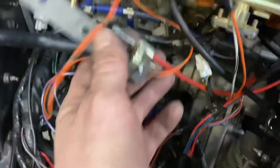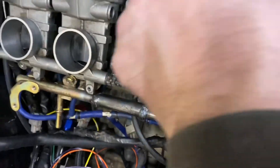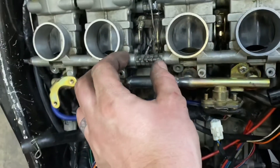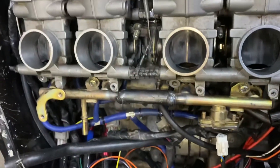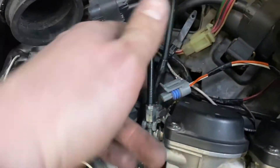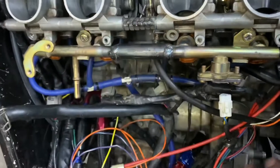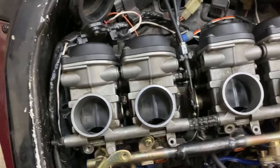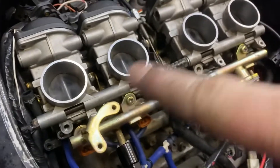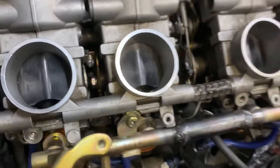Now I have my cable bracket for the idle advance — or the warm-up stuff. I might have to recreate that bar because I was a little too tight here in the middle and it wasn't fitting the boots super well, so I just had to redo it all. I also didn't like how that throttle cable was, and it's still a problem, so we're making small progress. I'm going to redo that idle up rod in a different video and I'll have to make a new one. I accidentally put these two throttle bodies in the wrong order — one's got a threaded hole and one doesn't, so that kind of screwed things up a little bit. I'll fix that later.